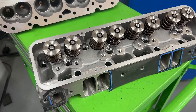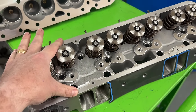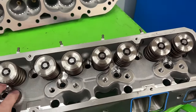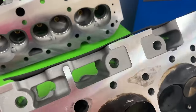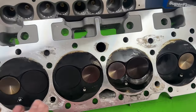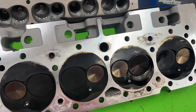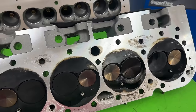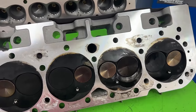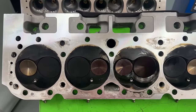The breakdown for this head: it's a 2.10 intake valve, 1.600 exhaust valve, and the intake runner is 235 CCs. Now, here's the weird part — I'm showing you this because it makes a huge difference. The chambers look pretty carboned up. It takes a lot of idle time for the engine to get up to temp so we can make a pull, because we want the water and oil temperatures to be the same or really close so they're not skewing the results. So a lot of this carbon is probably happening during idle time.